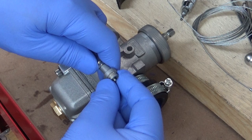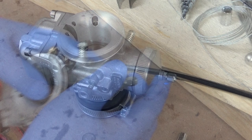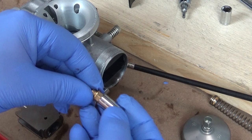Let's get the cables finished. First is the choke cable, but I'm only going to temporarily attach it, as I know I'm going to be trimming this cable later. The throttle cable now needs attaching. I decided to replace the BGM throttle outer case with a quality bicycle outer case. And I would have replaced the inner for the slick stainless inner, but I paid good money for this cable set so I might as well use it.